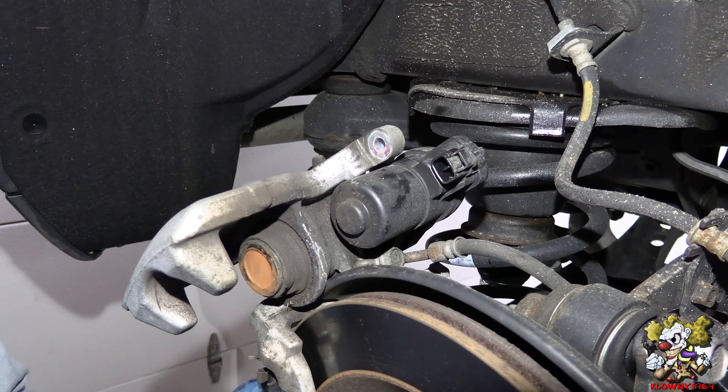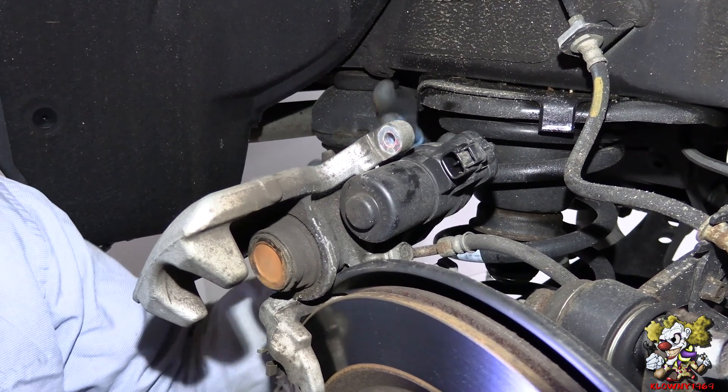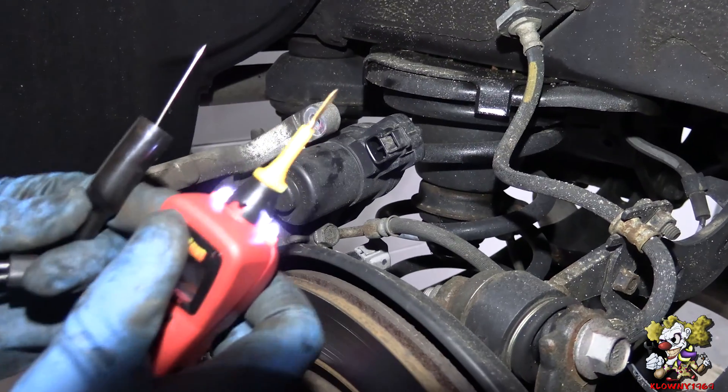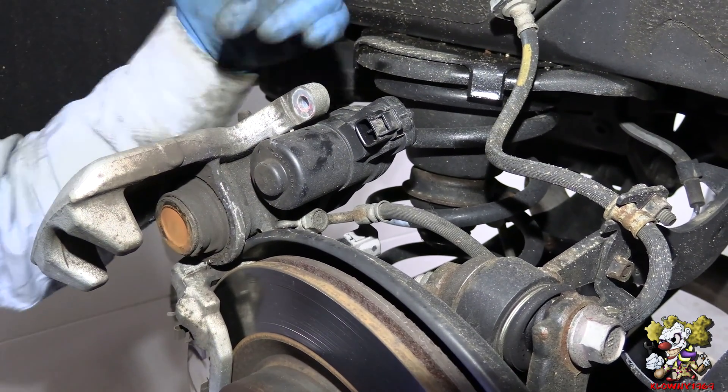Now there's different ways of doing this. You can do it with an expensive scanner. Or you can take this apart — there's a couple of bolts here — pop this off and manually wind it by hand. Or what I like to do is use a power probe and apply power and negative to this, and you can hear it unwind.